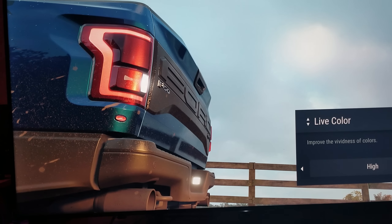When people say that turning Live Color on oversaturates the color, that is utter nonsense — it shows that person has no idea what they're talking about. They're either starting controversy or just hungry for views, falsifying information. Turning Live Color on enhances the brightness of that color, and that's what you want in high dynamic range. This is part of the X1 processing chip — a very powerful processing chip built inside Sony televisions.